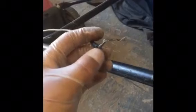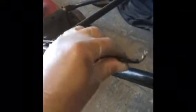What I've started by doing is I sprayed a little bit of lube into the sleeve here, just to help this cable move. A lot of the times the cables will get old and rusted, they'll get a bit of moisture in here, and they'll stop moving altogether, and sometimes when you put pressure on them to engage them, it'll actually snap the cable off right inside of there.